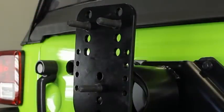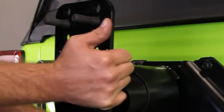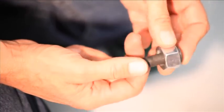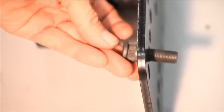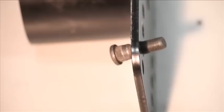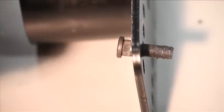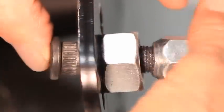We recommend using a press to push the studs in. Or, for those of you without a press in your driveway, try the following technique: find an oversized stack of washers or a spacer of some kind — even a large lug nut will do — and use it as a surface to push against. With the stud in the appropriate tire size hole, slide the spacer over the wheel stud and use a little grease on the threads of the stud and probably between the spacer and the lug nut as well. Thread the lug nut onto the stud and tighten it against the spacer. An air gun will really speed up the process, but you will be able to pull the wheel stud into place with hand tools as well.